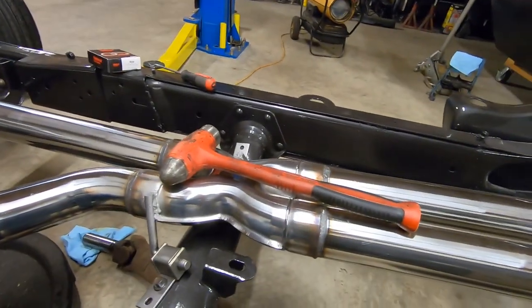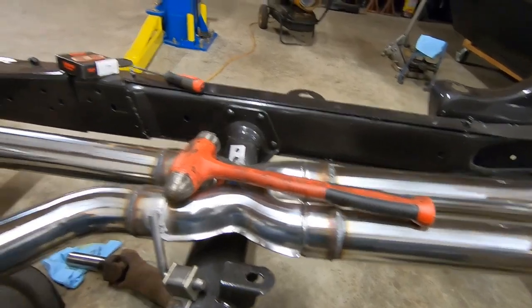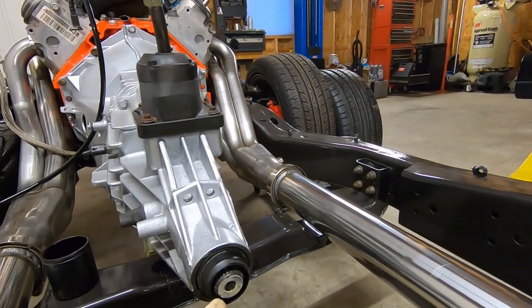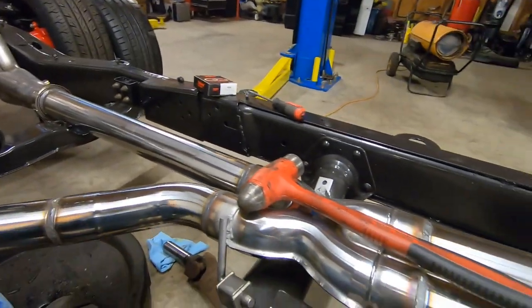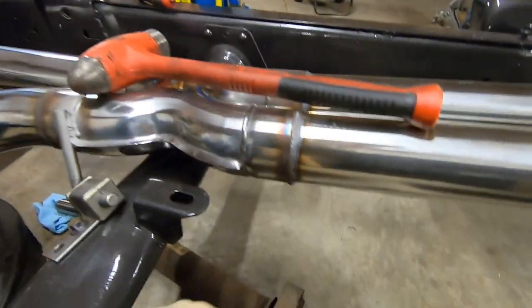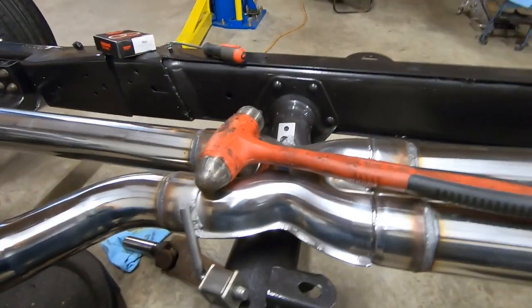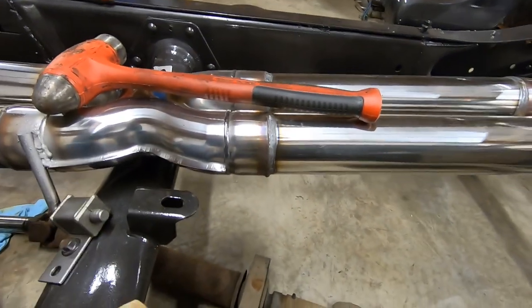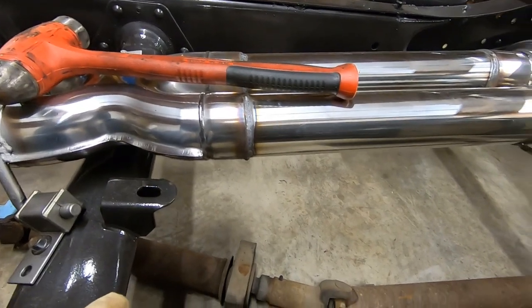The only thing we need to do now is take this drive shaft, slide it back on those splines. The splines don't line up any specific way. We're just going to orient our drive shaft the same way, so that this grease fitting is sticking up, and of course that sticker on there is going to be pointing up towards us too. It's always a good idea, anything that rotates, orient in the same spot to eliminate some vibration.